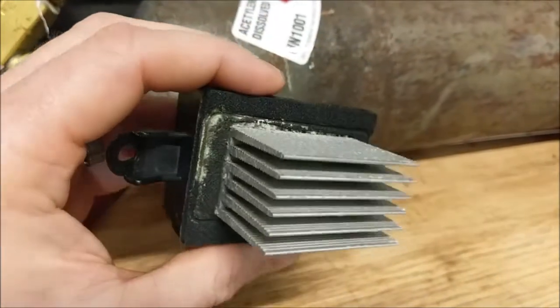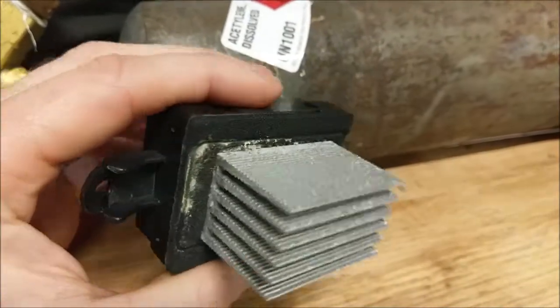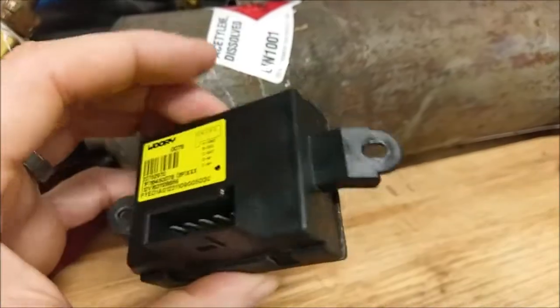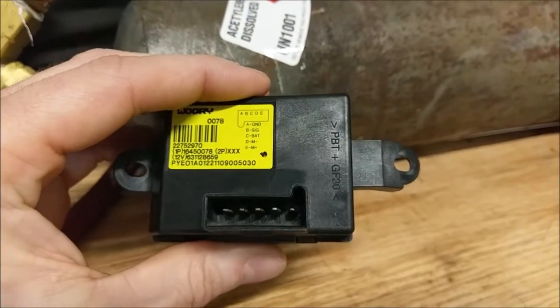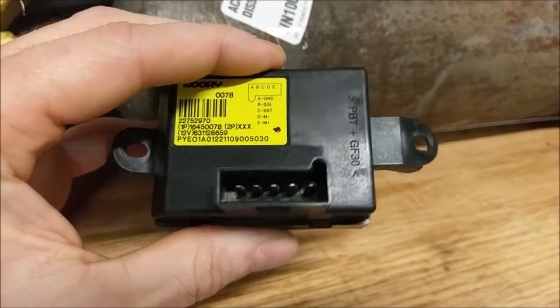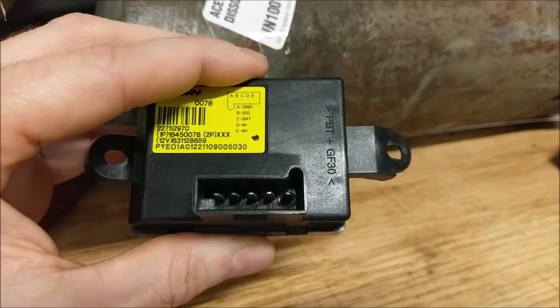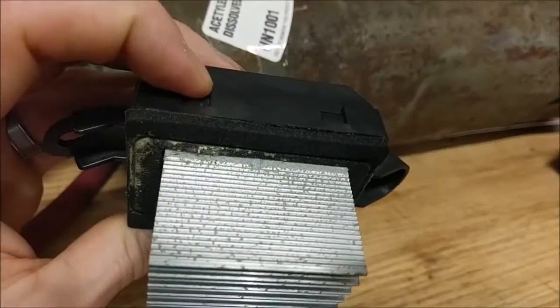Replace the pins — I'll put all the part numbers up later. So can we do anything about this? Clearly there's a defective design where you get a lot of humidity. Condensation builds up, gets down into electronics, eventually gets down into the connections. And of course your blower intermittently works, which is typically when it's freezing cold out or it's 115 degrees out and you're sitting in traffic burning hot. So let's see what we can do about this one and deep dive it more.